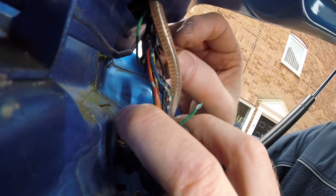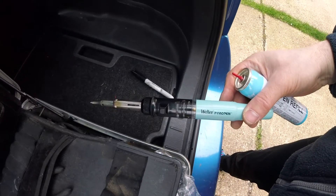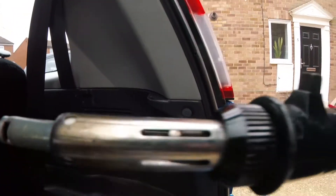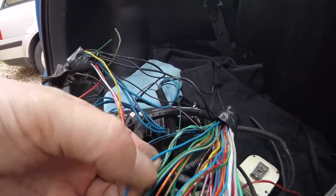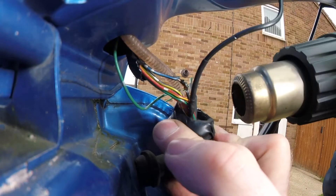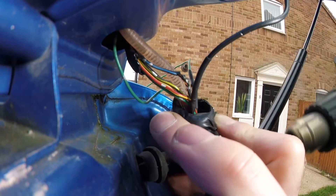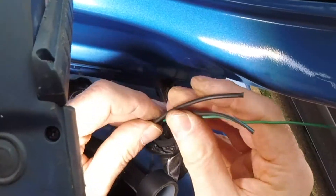You need to get hold of a decent soldering iron with a good thermal mass — not necessarily cordless, but cordless gas irons are handy. Don't just cut the wires and re-solder; extend the loom because I think they may have made an error on the design. Do one wire at a time so you don't get mixed up, as you can't see the colour codes clearly.